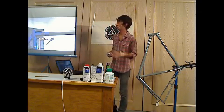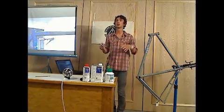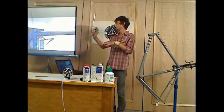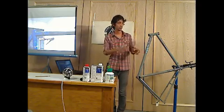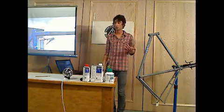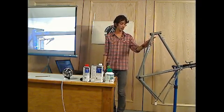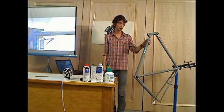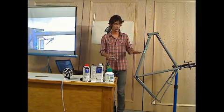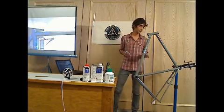The clear is kind of the trickiest part of the whole process. Everything else you can just kind of spray and deal with it as it goes. And if something drips in the primer, when you're trying to get that nice texture, you can come back and sand it out, usually with like some 800 grit sandpaper, and then you go down from there. And same thing with color, you can definitely get all that out. But once you have the clear, it's your final thing, and you want it to be really perfect.